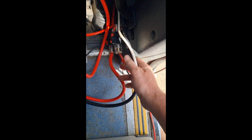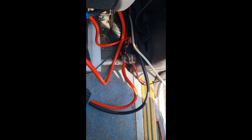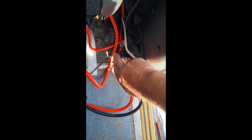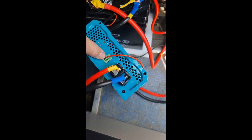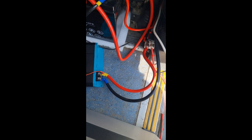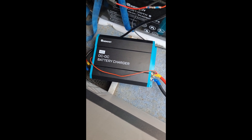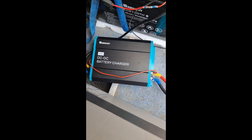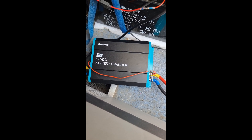It's all a bit jumbled up at the moment — I've got my solar array wiring to do yet. These are just flick isolator switches, and I've linked my lead to the positive main, so when I flip it, it'll turn straight on. I like to get my vehicle warmed up before I flick it on, rather than having the power straight away when you start the vehicle.